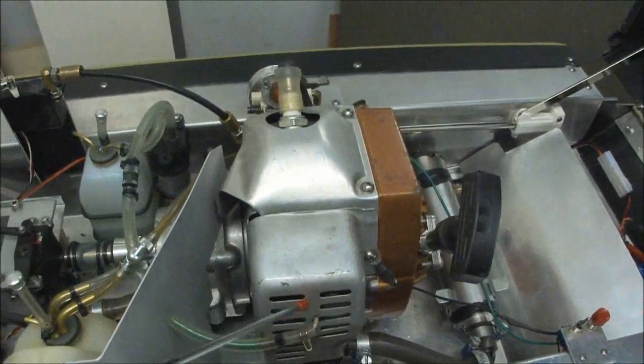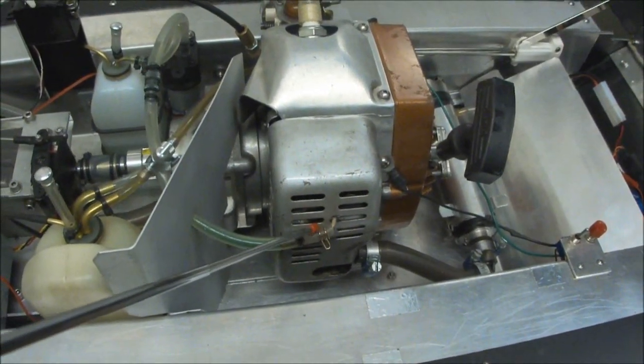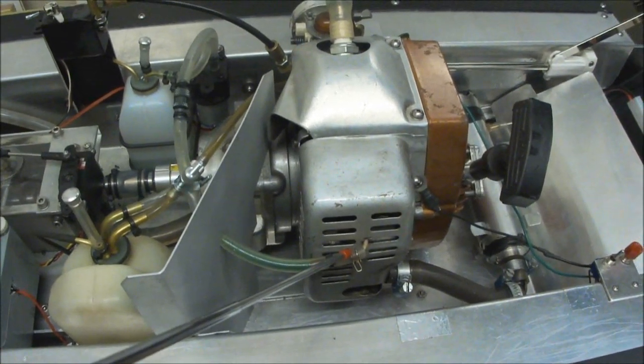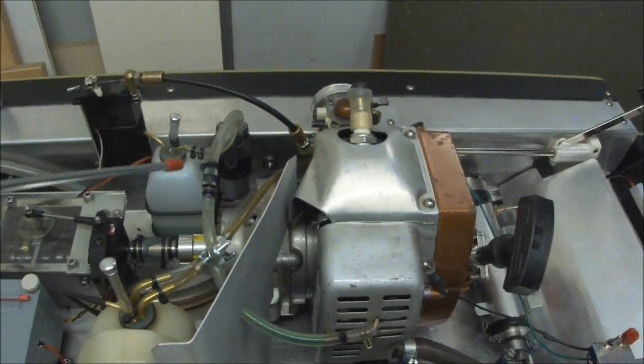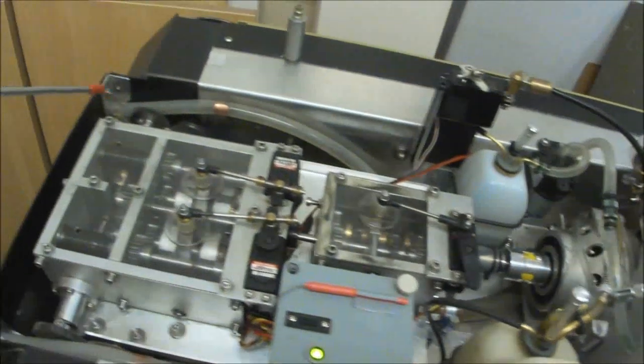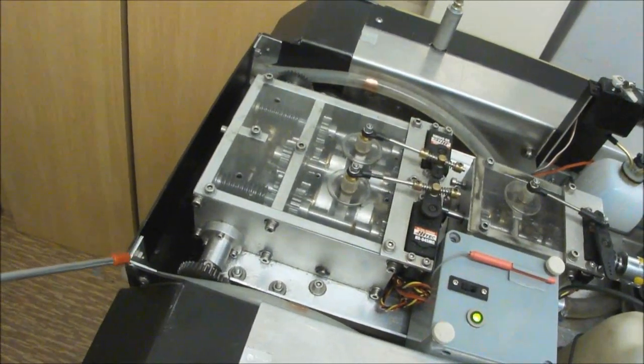Smoke oil is pumped into the muffler. A small copper capillary is glued into the muffler with a little JB Weld. It passes to the tubing and the muffler splits into two, coming out through these two silicone tubings.